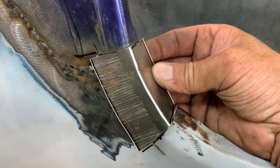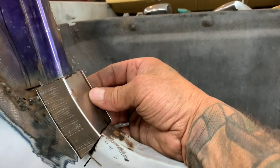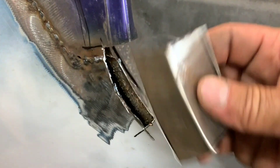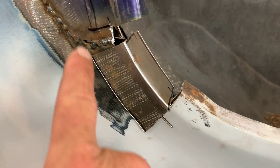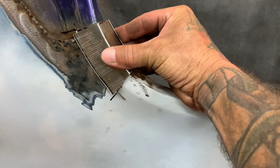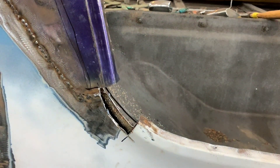I'm going to fit this piece in here. This is a no-show job — the guy doesn't want to spend a bunch of money, so we're blowing the thing together as quick as we can. I'm going to do the best I can and try to keep the hours down. Before I get it welded in, I need to put this body line in there. I'll take a sharpie and trim around that so when I weld I can flush-fit and weld that piece in there. Holy crap, it's hotter than hell in here today.